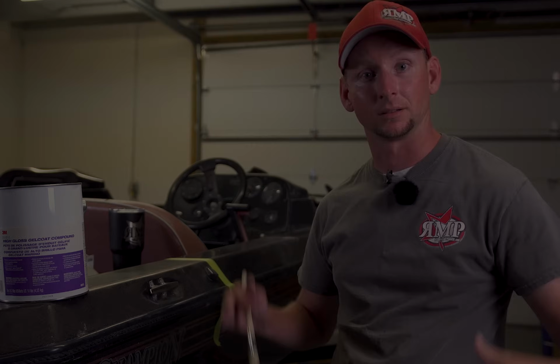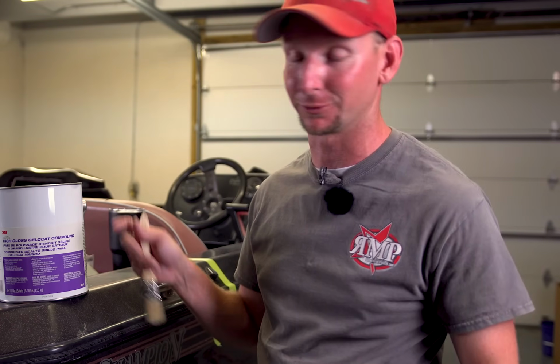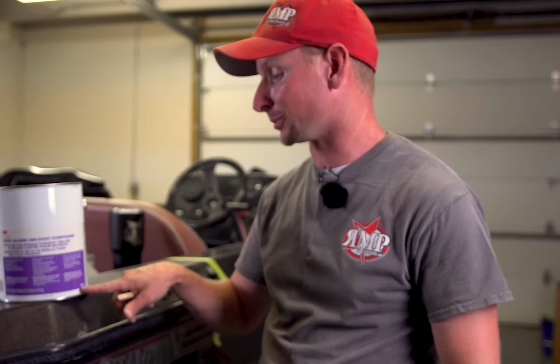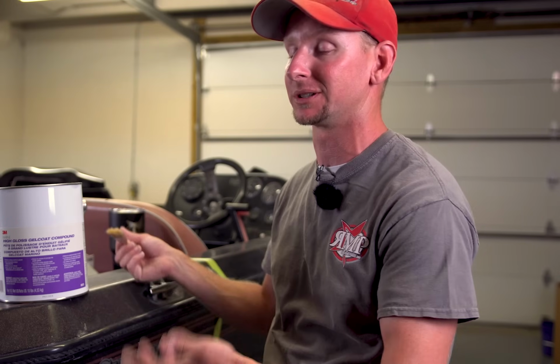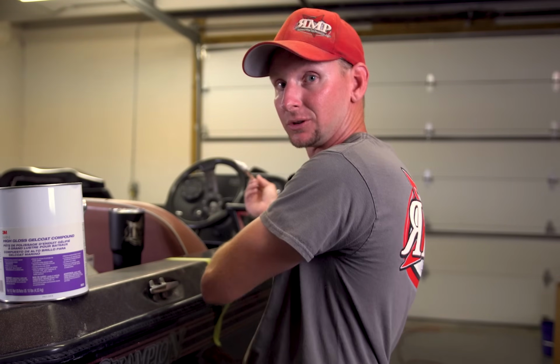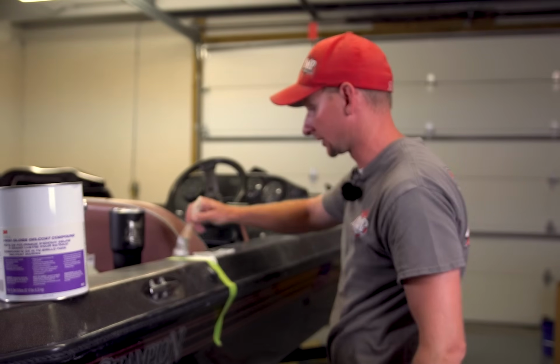All right. Next comes the compounding or buffing stage, and I'm gonna use, again, 3M product. No, we're not sponsored by 3M, it's just what we can get locally and what works well. This is the high gloss gel coat compound. Part number is 06025. It comes in like a paint gallon bucket. It is expensive. You can get multiple boats out of 1 gallon of this stuff, but it works really, really well and it's specifically formulated for gel coat. So I like to use a little chip brush and we just kind of dab it in here. Now we're actually going to apply it to the sanded portion of the boat, okay? So get some of this and we're just going to lather it on here.